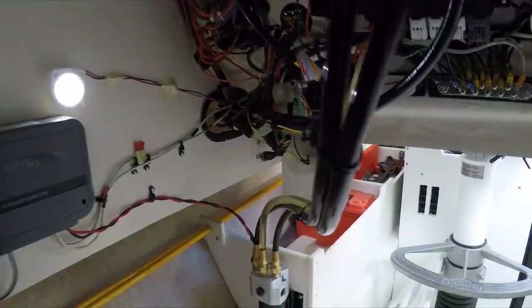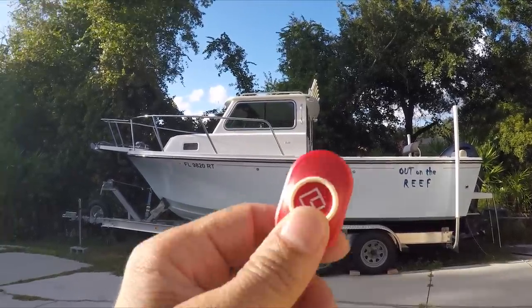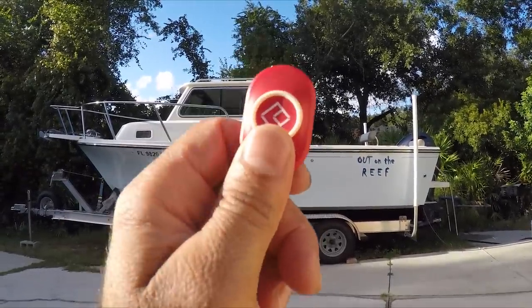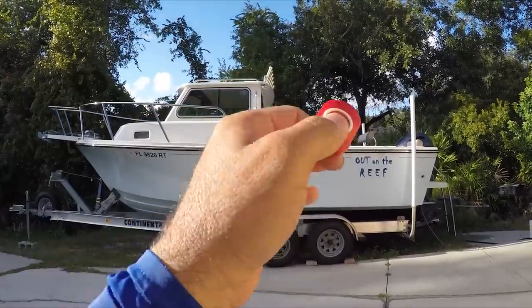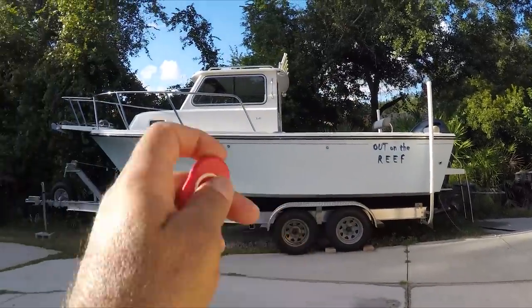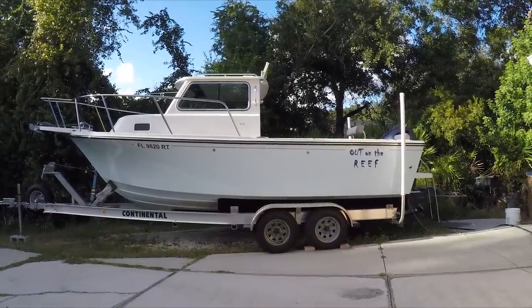I hope you found this video helpful. I'll place the link in the description below for the system and the accessories so you can check them out. I highly recommend it because I will now be a lot safer at sea. Whether I fall from the boat or I'm trolling, this is a great device — the engine runs at five to eight miles per hour and if I fall off this will shut it off. Once the fob has contact with water it loses antenna range at about 50 to 60 feet from the boat. Please give the video a thumbs up, thanks for watching, and navigate safe.